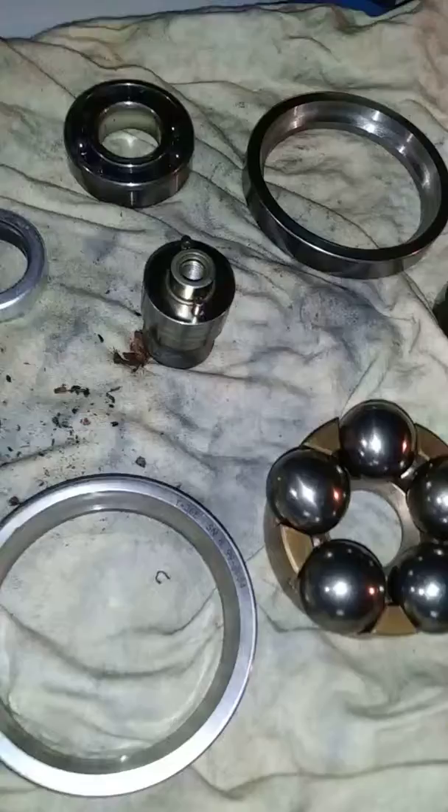Alright, again you have my Paxton SN-93 unit. I opened it back up real quick after doing my mock-up to see that it's working right. I opened it back up to show these are the old parts — this is the old damaged impeller shaft, pitted. See how pitted this is in here.